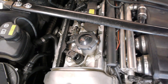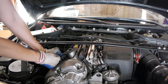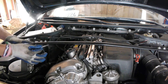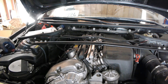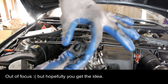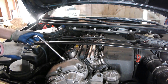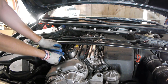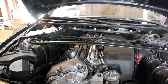Then get to the coils — remove the coils and remove all of the spark plugs. To remove the coils you just flip this up, remove the electrical connector here, and to pull out the coil I usually just hang it up with a screwdriver, pop it off, and repeat for the others. Sometimes they're a little stubborn so squeeze the sides while lifting up — that releases it. Next remove the spark plugs from all the cylinders. My five-eighths socket lost its rubber piece so I just use some pliers.